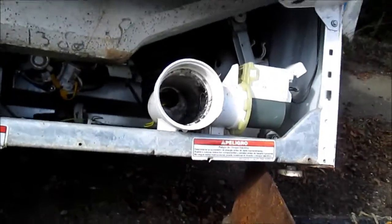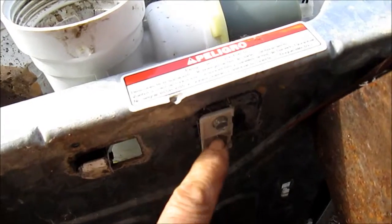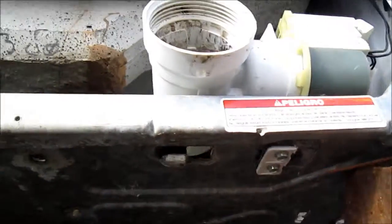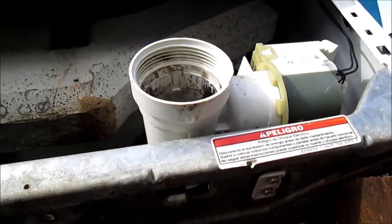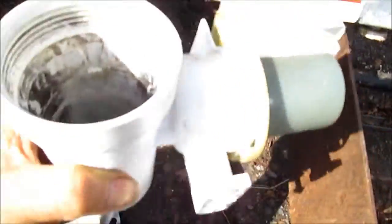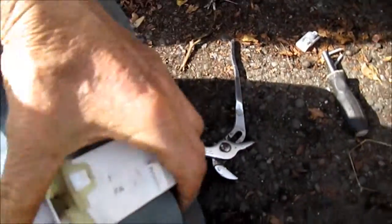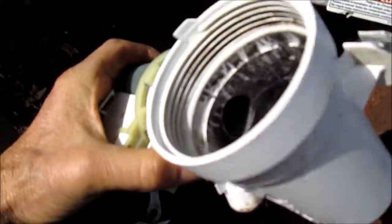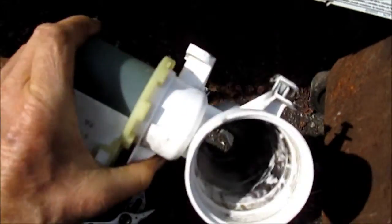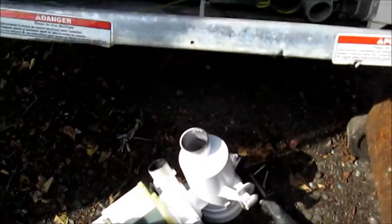This pump is accessed from the bottom. There are two screws right here that we have to remove in order to take the pump off. Once you pull the two screws off, you just lift up and push this way and it comes out, then take your hoses off. If we shake this, you can hear that the impeller is loose inside there — that would not pump the water out. So there's a good chance this one is going to be fixed with just a new water pump.